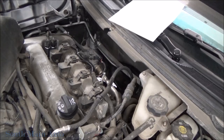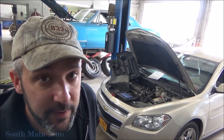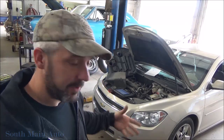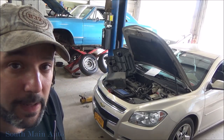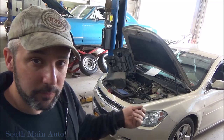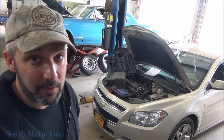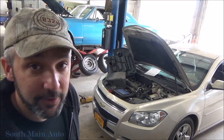So that's it. The conclusion is the pressure sensor is bad. These are super easy to diagnose assuming you have a scan tool — you can do it without one, you can turn the pump on manually, but you have to get under there and it's a little trickier. The solenoid relay is right here in the under-hood fuse box — you can open and close that with 12 volts. It's kind of silly that just a pressure sensor has failed, but now we've got to buy the whole valve in order to fix this car. That's the way GM designed it — we're just here to fix them.